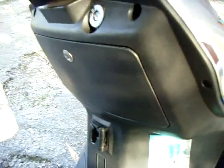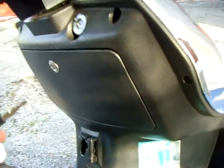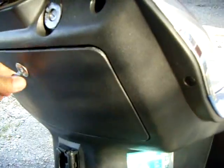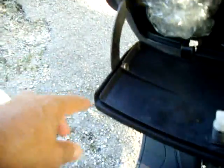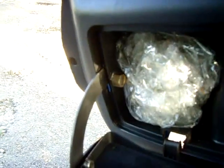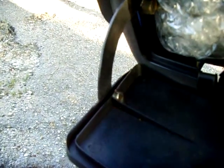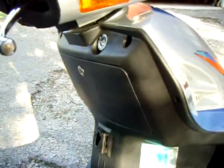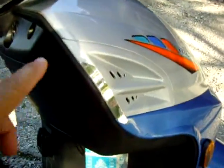Glove box was a disaster, as you know, on most of these Chinese scooters. These don't fit right, so what I did, because I don't want to invite a bunch of lowlifes that see a glove box that's partially open to start prying on it to get in there, I put magnetic catches in it. I mean, it might not be the prettiest thing, but there's a neodymium magnet. The plastic was all sanded and bonded with E6000, both sides. And on each side is one piece of brass like that. Inside that brass piece is the same magnet that's down there. And when they come together, it holds the door nice and tight and straight. You don't have to do anything, just like that. That's it. See? Nice, stays tight. It doesn't look crappy like the other ones you see on YouTube. I added this piece of chrome too, this stainless.